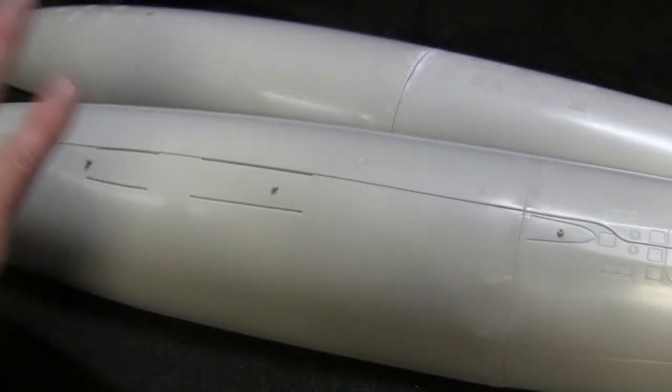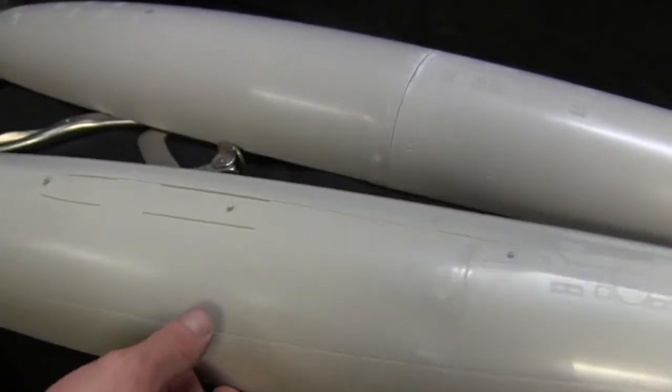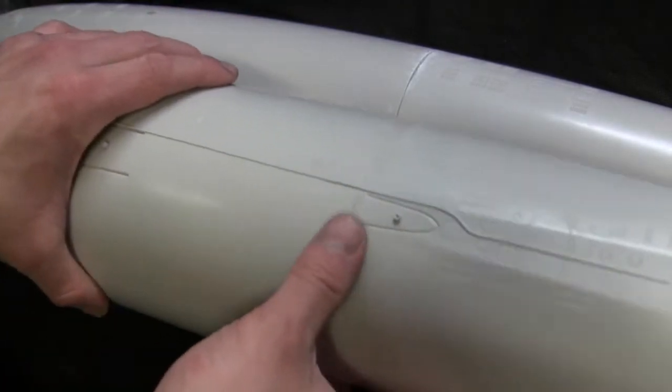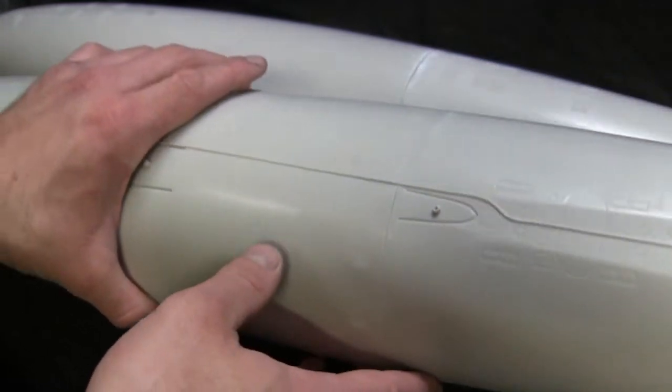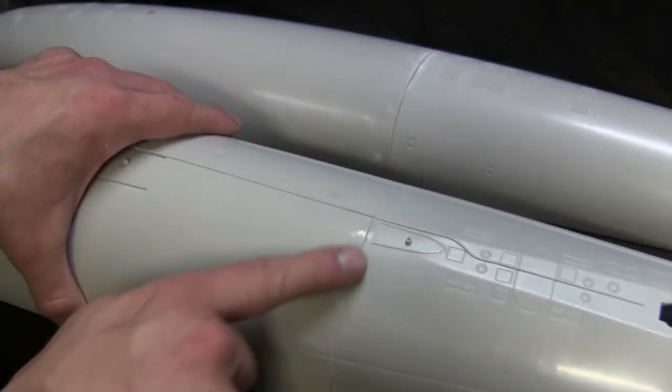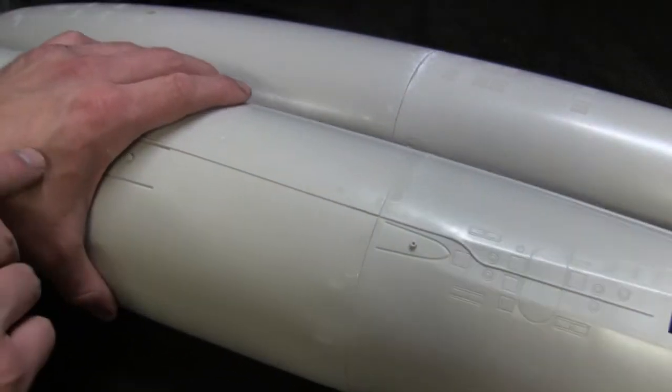I'm going to be going into more detail on that as the video goes on, but from here, I'm actually going to go ahead and start with the bodywork process. For the one here on the top, it's not too much. What I'm going to do is I'm first going to polish down the area with a little bit of hand sanding, and once that's done, I could apply a small little thin smear of red putty.